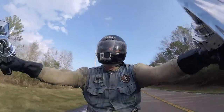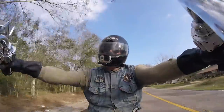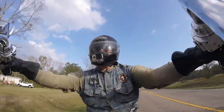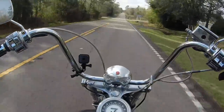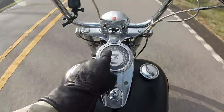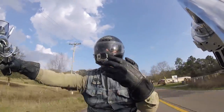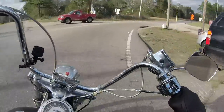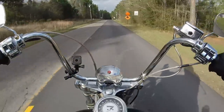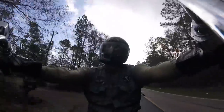Since I just cleaned the plugs I do notice a little bit of a difference. This is a lot of fun, other than the fact that because of the forward controls my right foot combined with the air cleaner — I have to hold my leg there, I can't just relax it because my foot's going to fall right off the peg. The speedometer doesn't work either — I had to pull the speedometer cable out when I put that front wheel on because that whole assembly isn't meant for a wheel-drive speedometer. Until I get a transmission case with the option to put a speedometer drive in, I'll just be riding around with no speedometer.